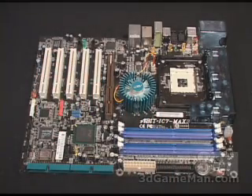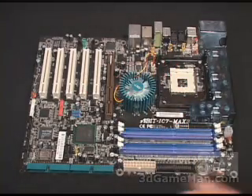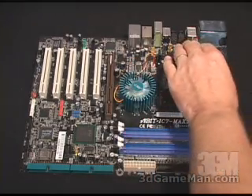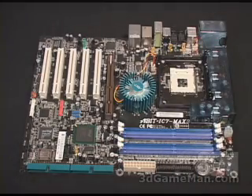This motherboard does have active cooling on the chipset, a nice large heatsink and a fan. Two power connections, one right here and one right here. Also, five fan headers on the board, but two of those are taken up: one by the cooler on the chipset and the other by the OTES or Outside Thermal Exhaust System. The three that are free — there's two right here and one right here.